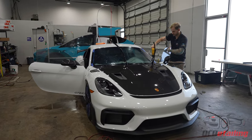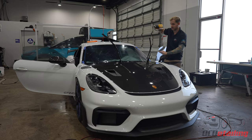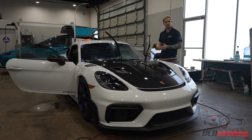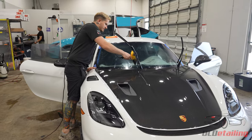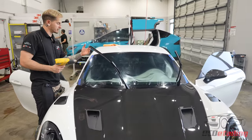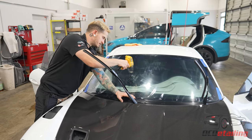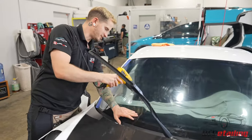If you're a new owner who just got your Porsche, it's beautiful and you want to keep your interior nice. The one thing that's going to destroy your interior faster than anything else is the sun's rays. You need something that has not only a high UV rejection — because UV rays are the number one cause of damage to your interiors — but you also need something that has a high infrared rejection. In my opinion it's just not enough to only do the sides and the back window, because your dash has so much visibility to the sun and you're also sitting right there by the windshield. If you're not protecting your dash you're not protecting yourself, and this is the largest pane of glass on the vehicle, so it's something I always recommend tinting. And not only that, it looks cool.